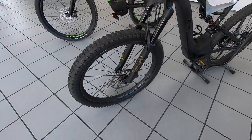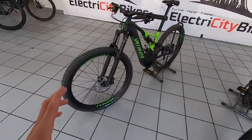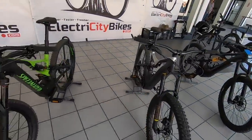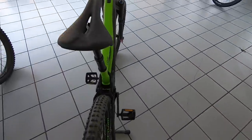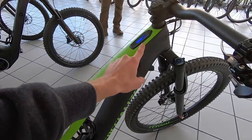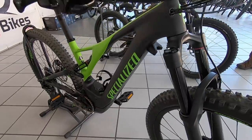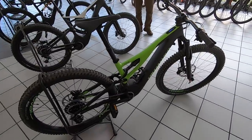It's got the 650B 27.5 by 2.8 tires versus the 29er's 2.6. We were talking to a rep from Specialized, and they said this is a little bit narrower, kind of nimble. The effective diameter is very comparable. We also were looking into this sidearm design and some of the benefits. One is that it's a little bit lighter weight, so there's less material, and they were able to run the cables through the frame right there instead of on the down tube. That comes back to the whole battery redesign and how it comes out the bottom. So that's worth exploring here. That's kind of a big design change.